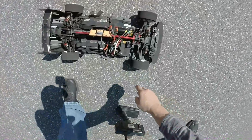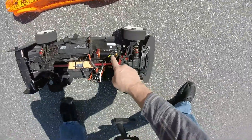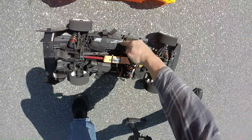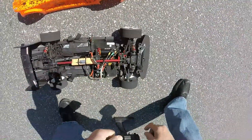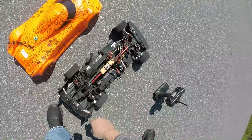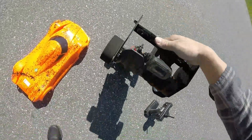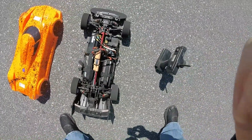On this one, no fan — running the MMX ESC and a 4050 motor. 6S lipos, two 3S in series, and a ripple killer cap pack. Mild setup, like I said. First pass on what will be an 8S setup, and it kicked off 114 mph. That's not too bad — I figured 130 is no problem. Appreciate you watching.